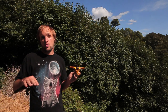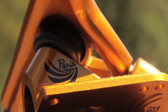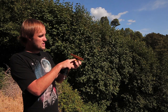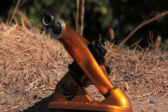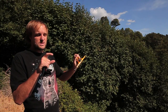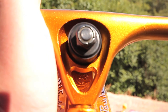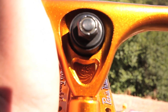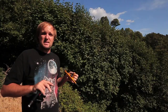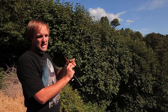It's a slower turning truck and it's going to be more stable at higher speeds, and it's going to allow you to have to move your feet more to get the board to actually turn. That means it's going to be less twitchy at those higher speeds as well, so it's better for a faster type of riding. You're going to notice a barrel on the bottom with a cupped washer to keep that stable center point, but on the top you're also going to have another barrel. This is different than the 50 because the barrel is going to provide even more resistance and return to center, but with a flat washer on top it allows the bushing to move more in the bushing seat, giving you extra pop and dead space at a certain lean to really kick the wheels out and slide.